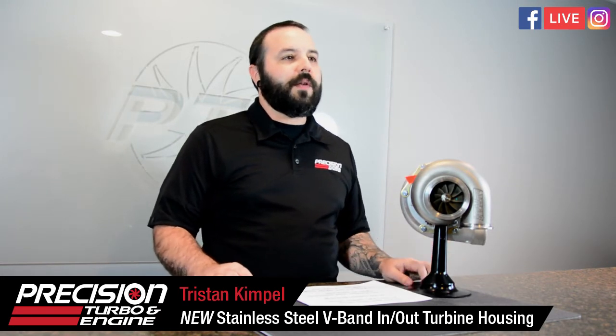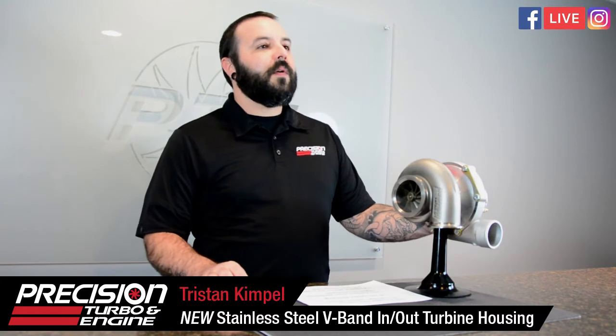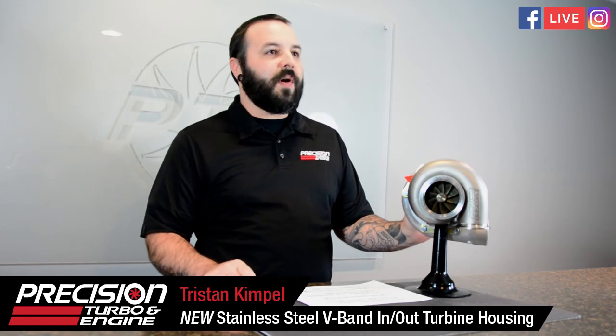To reiterate, it is a 1.05 AR — quite a bit larger than the ARs we had previously. It's been tested and worked out really well: twin turbo applications, 68/70s on a GTR, and 64/66 or 62/66 single turbo on a Subaru. It also opens things up for guys running Hellion turbo kits with v-band in and outs — if you were a little power-limited at higher horsepower levels, you can now step up to a bigger housing, free up the exhaust flow, and push a little harder.